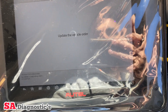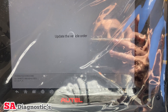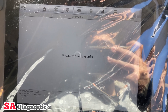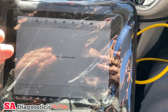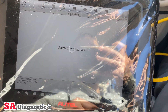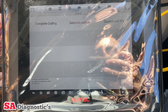It'll update the vehicle order and that's it. There's nothing very difficult — it's dead straightforward — but you've got to be careful what you code and what you don't, because it will erase some faults. For instance, I've updated the gearbox on a 7 Series before and it then triggered a problem with the ARS stabilizer. The gearbox was fine, but it lost its sync with the vehicle stabilizer. You'd then have to go into the ARS section and do a calibration on a flat surface. It will warn you, but you've just got to read carefully and ensure you're doing the right thing before pressing OK, because once it's done, that's it.